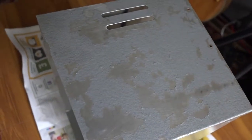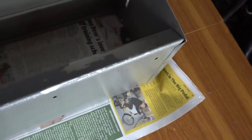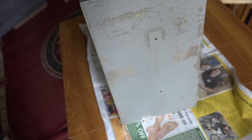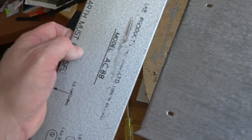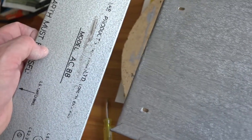I've just cleaned the cabinet and the paint had been flaking off quite a lot. I've rubbed it all down and on the front you can see I've removed the paint, taken off the badge, taken off the handle, and rubbed everything down. I'm now going to paint the cabinet using some ordinary metal Hammerite. I used this before on the other AC88 I had and it looked pretty much like it was new from the factory. Here's the original panel and here's the one I've painted - it's slightly darker but close enough I think.